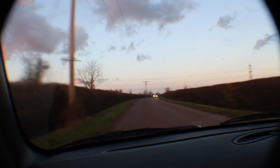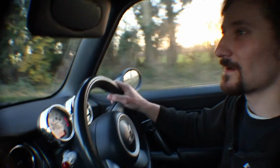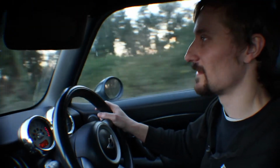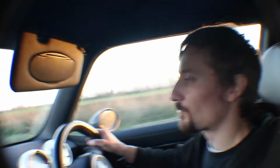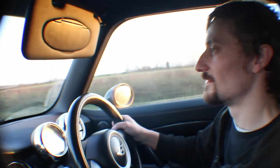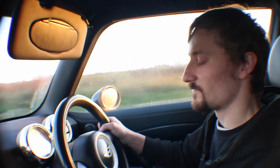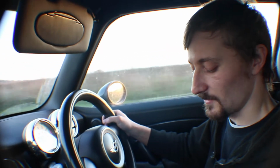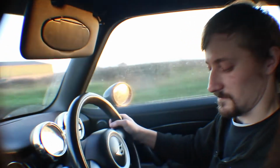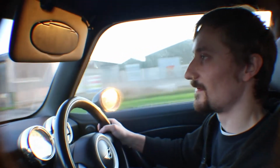Yeah, it's got a really stiff gear change, which is quite annoying. Apparently that's kind of common. Apparently they just like that from factory. They do get worse as they get older, so you have to basically just grease up the cables, or we'll probably end up just putting new cables on it, and then probably greasing them up before we put them on. I'm not sure if there's anything that can be done. I guess if there was an aftermarket solution, somebody probably would have done it by now. I've got no other complaints with it really, other than that.